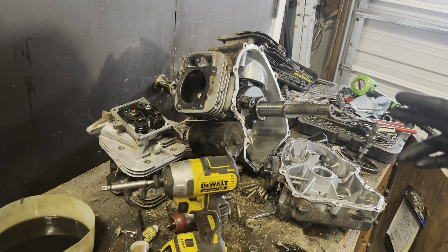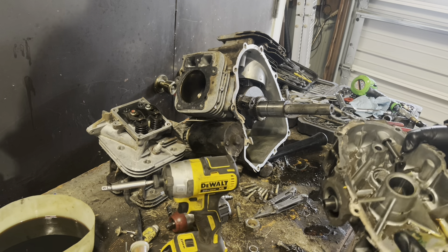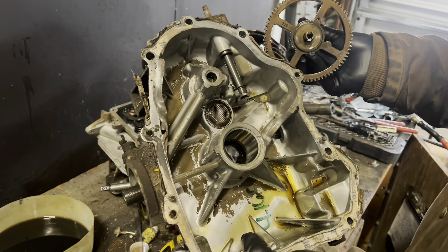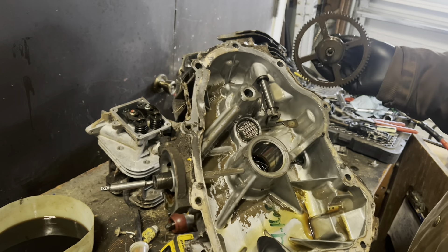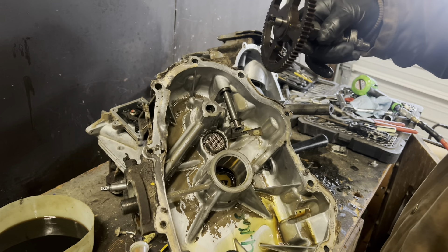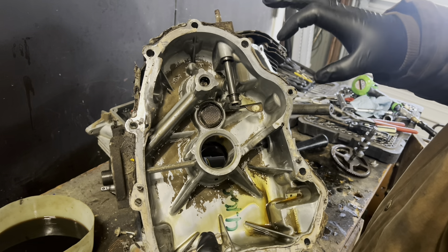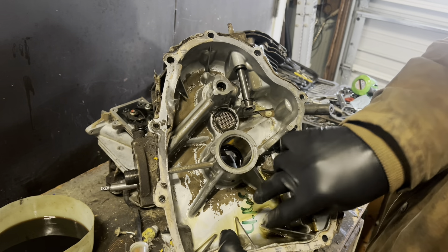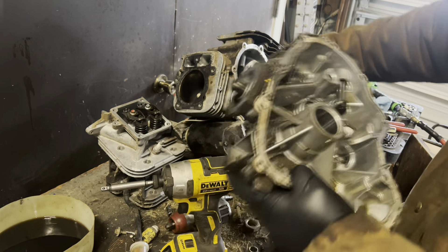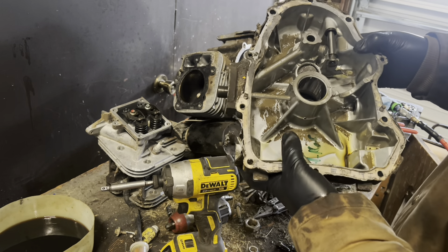Customers are taken care of, now we're back to the camera. The hollow camshaft is for lubrication purposes. The teeth on the end of the camshaft actually drive the oil pump here. In Kohler engines, it's an independent little pump that runs on its own gear that connects direct to the gear on the crankshaft, and that flows oil throughout the entire engine.